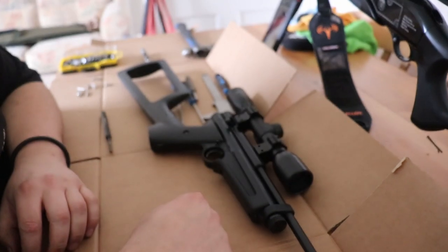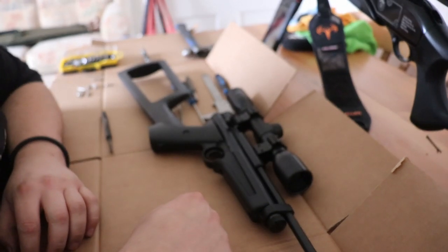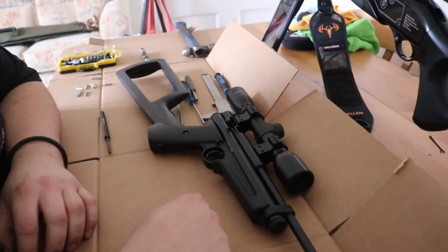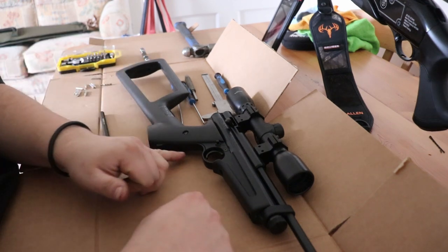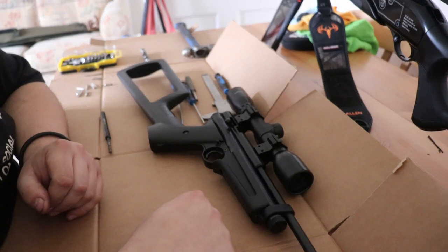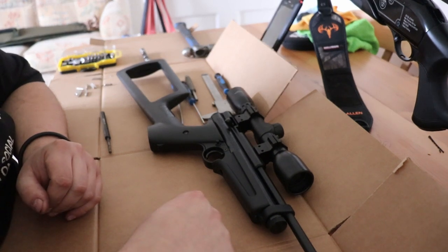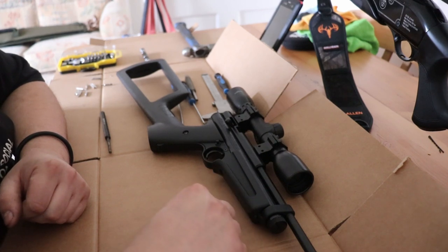What I'm about to show you today is how to remove anti-tamper screws. To disassemble the whole thing, you've got a screw on this side and a screw on that side, and you've got to take those off. They used to be held in with a screw that just had a domed head with a slot on either side all the way through, so all you needed to do was grind up the middle of a flat screwdriver and that would work.